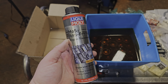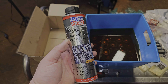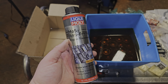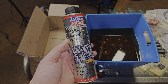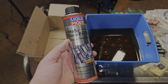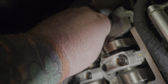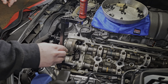This is your M156 timing tool kit. This piece locks the cams in place. This other piece times the phasers to make sure they're in the right position when you put them back. This one sets the spacing of the phaser ring so you can put the phaser on the cam gear. And this is the plate that slides into the back of the cams — there are little indentations in the back of the cams; the plate slides into both and tells you you're in time.